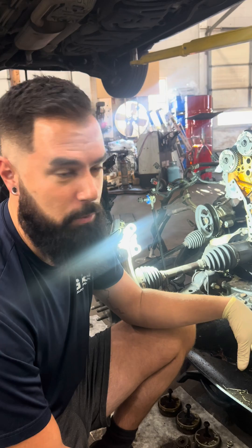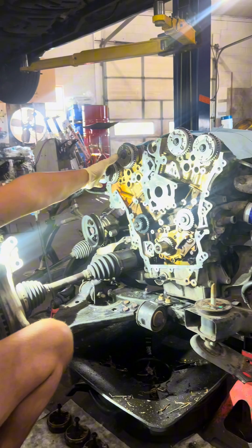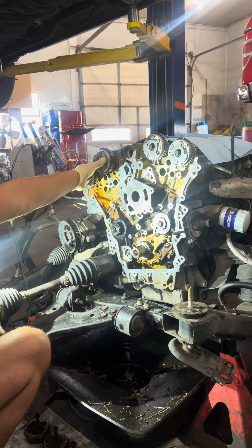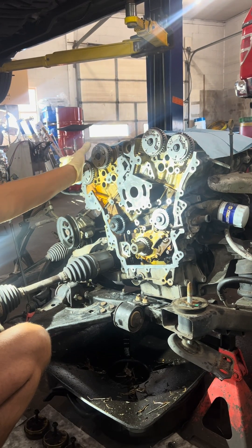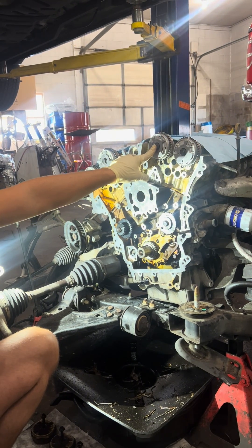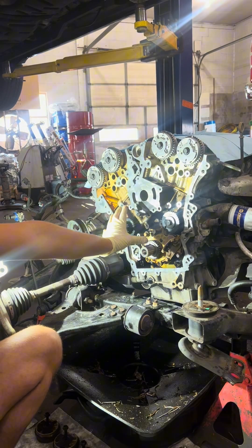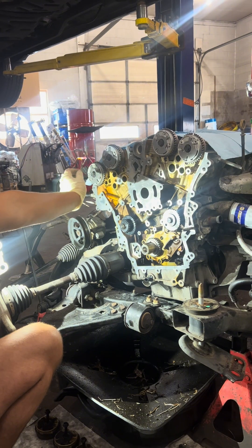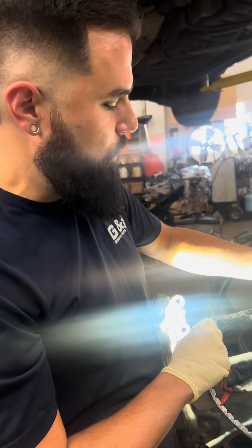This can be done in the vehicle — it's a little more difficult, so if you've got a way to drop it, you can do it that way. Something that's common on these vehicles is the camshaft phasers. These phasers fill up with oil and adjust the timing in a retarded or advanced state. I've already installed the new phasers and torqued down the brand new bolts to 43 foot-pounds. I'm going to set the timing chain in one single phase — not rotating the engine three times like the manual suggests.